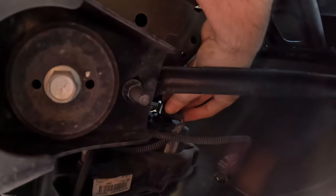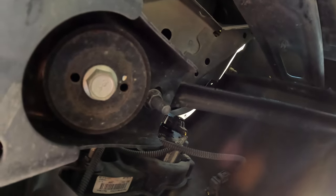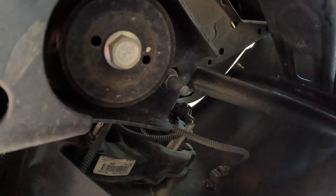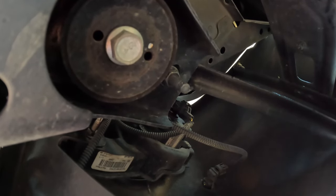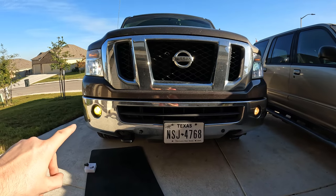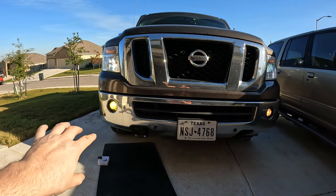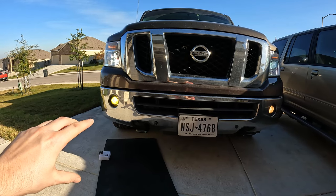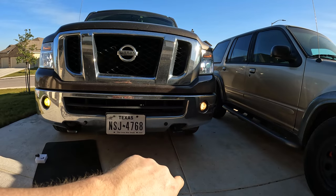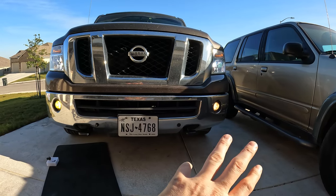I'll go ahead and get the car started back up and look at the fog light — a daytime comparison between the halogen on the driver's side and the new LED on the passenger side. It won't be a nighttime comparison since I'll have both installed before dark, but it'll at least give a general idea of the color and brightness difference. The 3K LED is much more amber golden colored and should be much better at dispersing through fog while still letting you see the road. The halogen is that off-white — around 4500K or so — and just doesn't really work well in fog.